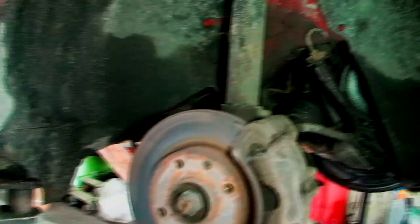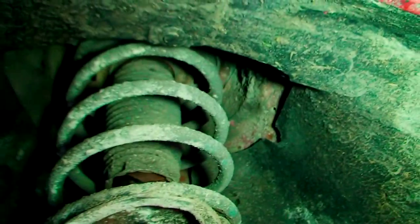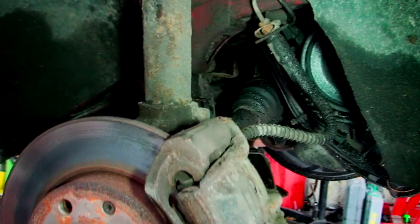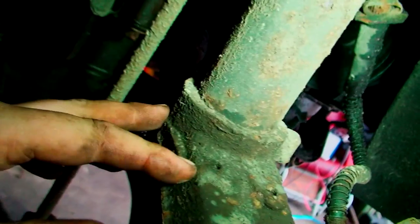As you can see, I've got the wheel off. And basically underneath there in the spring — you're not going to be able to see — right at the top of the spring is the shock top. Now, there's a couple of different ways of taking this off. Both of them kind of have their own drawbacks. We have to, on this particular car, either take this bolt off to take the spring, or the actual shock out of the hub, or take the bottom wishbone off, which is obviously here.